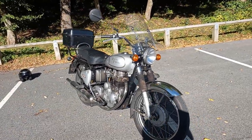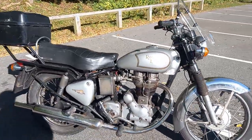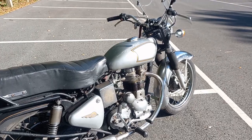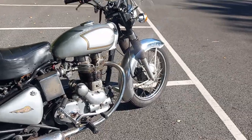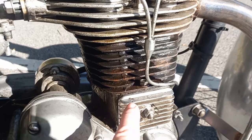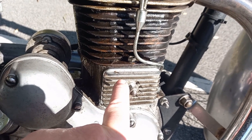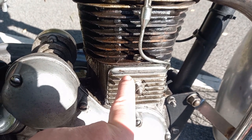In fact, this is a few months later. This is probably going to be the last run this bike's going to have this year. I've had a few minor technical issues with it. I took it out to Whitby; on the way back it started cutting out at junctions and then later lost compression altogether. I had to do a quick tappet set and put the gap back in the tappets. I'm not entirely sure why that happened - there might have been a bit of corrosion in the bearings and on the cams that's worn away and resulted in a rapid change.